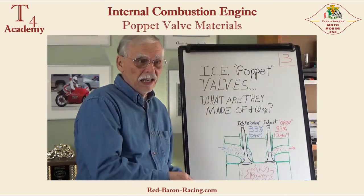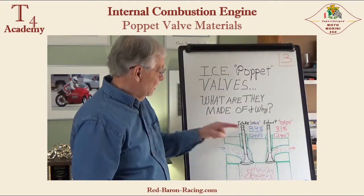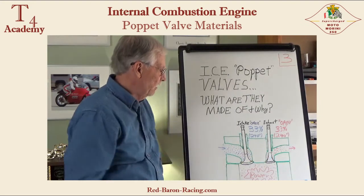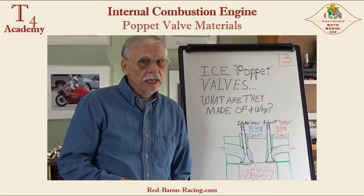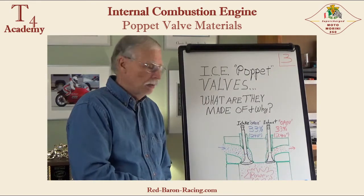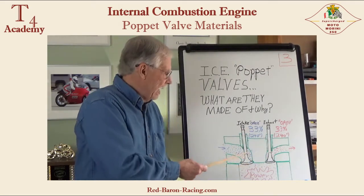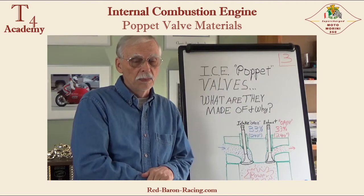Over here on the exhaust, you need to handle heat because this thing runs hot. A radiator cap on a $500 car isn't even close — this thing is extremely hot. It has to handle massive amounts of heat. So the grade of steel has to be high-temperature steel — more expensive to make, harder to machine. In higher-performance applications like turbocharged motors, stainless steel may not be enough. You may have to start adding nickel and cobalt and other additives, which raises the operating temperature the valve can handle — but it also jacks up the price.